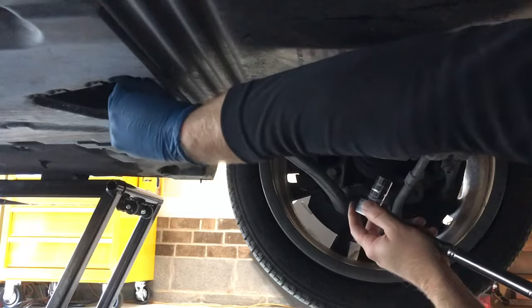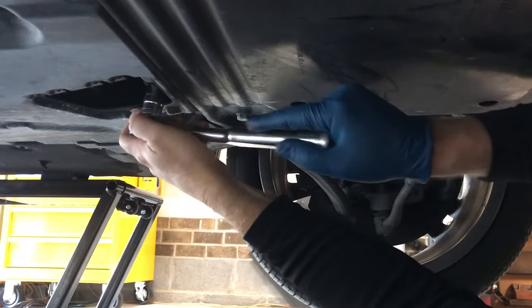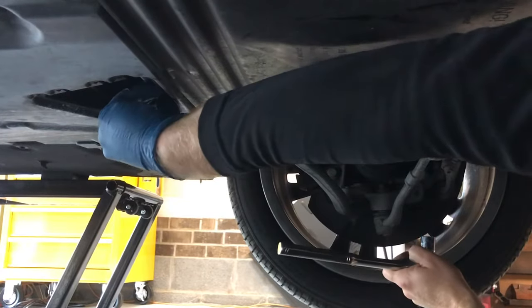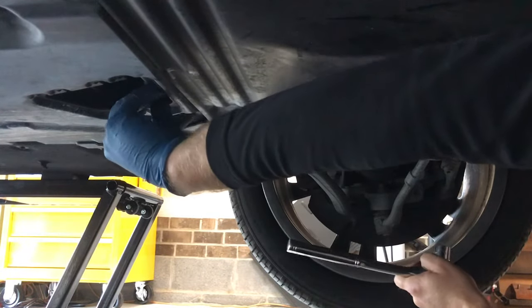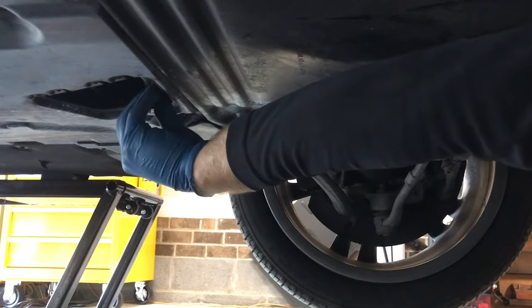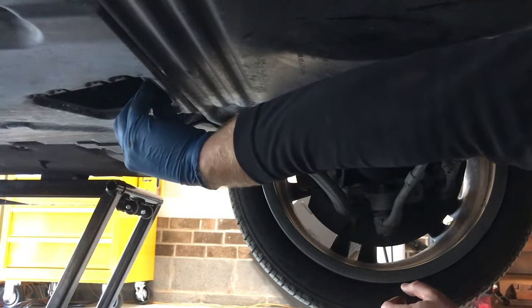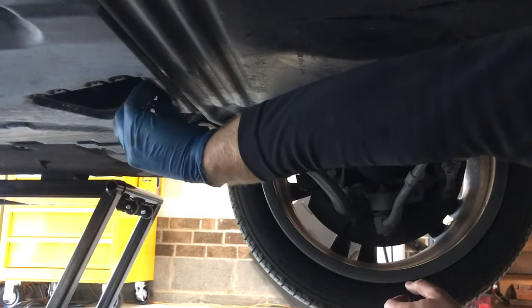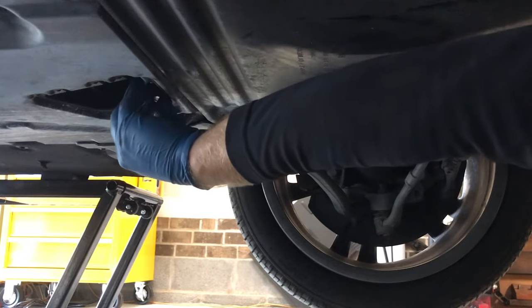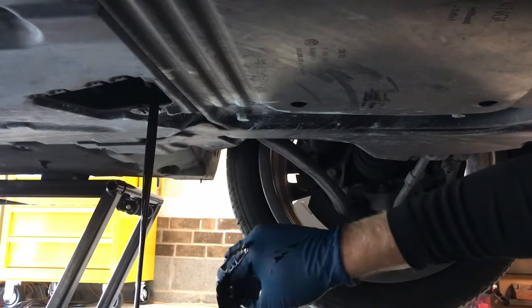or else you're going to get oil all over you. All right, I can turn by hand, so as I'm loosening it, I'm also pushing it up to keep the oil in there, because as soon as it's loose enough to remove, I'm going to move it fast to get my hand out of the way of the now warm oil, and the other hand on this pan to be able to reposition it if this stuff sprays everywhere. Okay, here we go. All right.